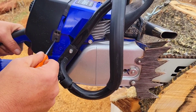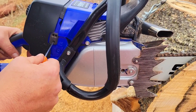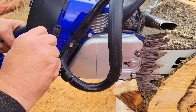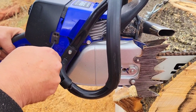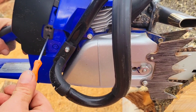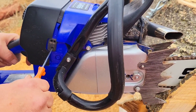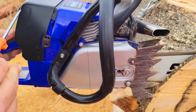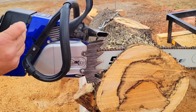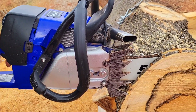I'm turning out my idle to match my low jet — that's something you can do. Notice my idle coming down. I'm getting around 2,500 RPM again. It's much better.